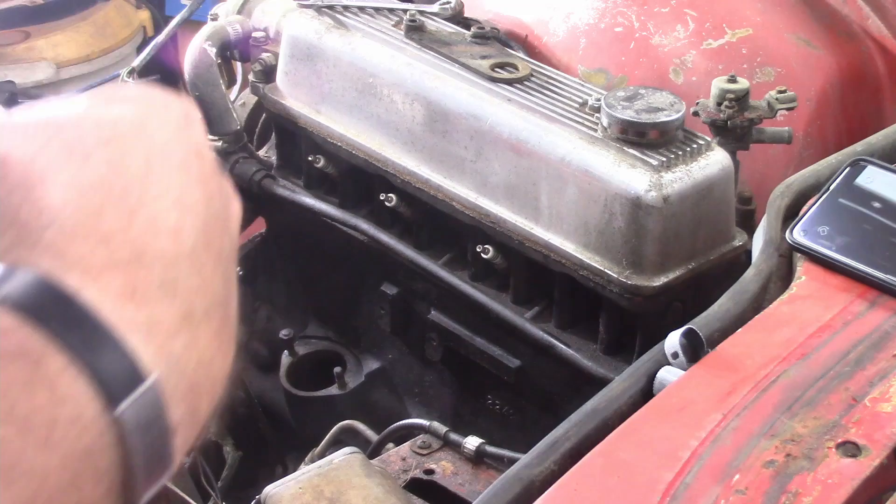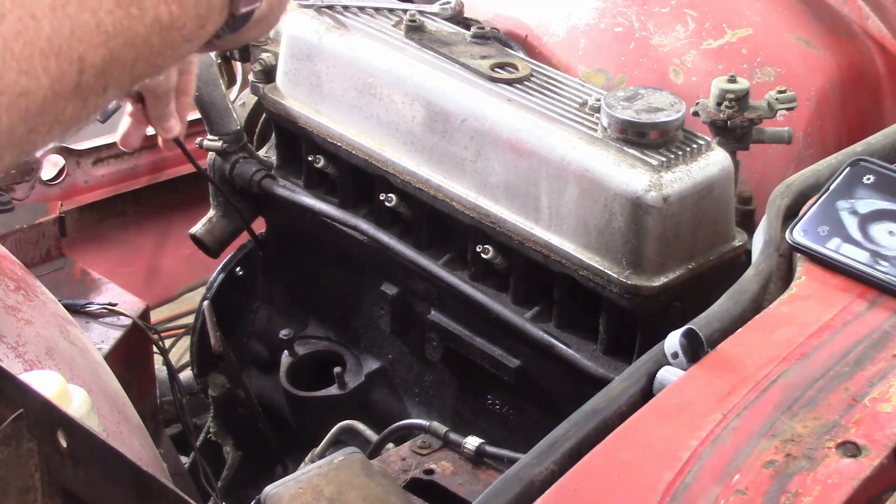Good crosshatch — still looks like crosshatch everywhere. So that's reassuring. Going down into the distributor hole here, down into where the oil pump cavity and shaft go. Yeah, that's not incredibly exciting, but it doesn't look too bad. Then into the motor itself — let's see what we see. That looks like a connecting rod. Yeah, that's a connecting rod.